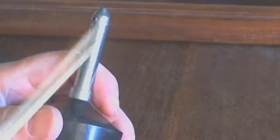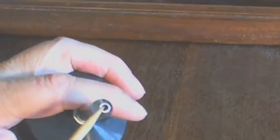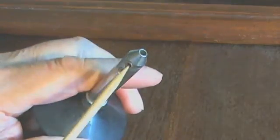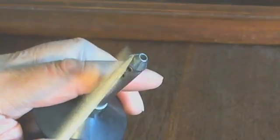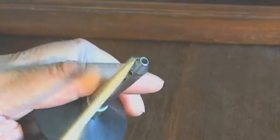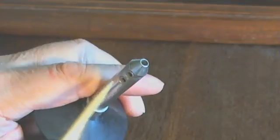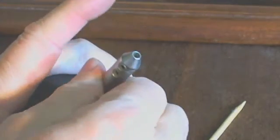Okay, I'm going to get right to the point. You all talk about water getting in through this part of the antenna and through the top. That's possible because right here this little hole is where the stinger goes in, and it's got two little set screws that tighten it down and push it to the opposite side of the hole. There's a little space in there and water could sure get in there, and since it's pushed to one side it opens up that hole even more.